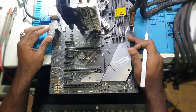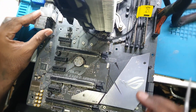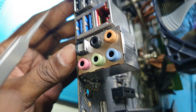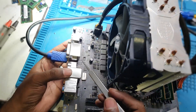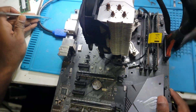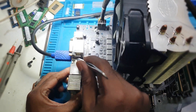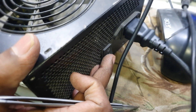We have repaired the board now. Due to the non-availability of a microscope camera, we were not able to record that part - we are just recording from a mobile. Here are some USB ports inside the board. After diagnosing and checking, we found one component in this area which we have removed. This component was causing the board to shut off after 15 seconds. We have removed it and disconnected these two USB ports entirely.